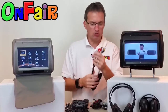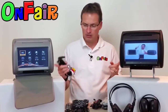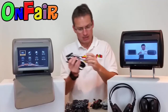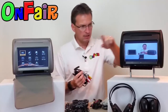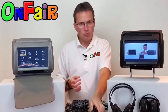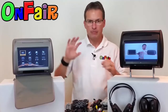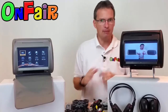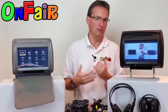These are universal RCA cables, so if you want to connect to an in-dash unit instead, you can. Another nice feature about the Dreams is they have pass-through audio video. You can connect the audio video from the in-dash unit to this DVD player and then to this DVD player. At that point, both headrest monitors can see what's on the in-dash — it's called pass-through. When you do that, you've lost the input on one unit, so that one cannot be the master for the other without extra adapters. But this unit could still be the master to the other, and the in-dash could be the master to both of them.